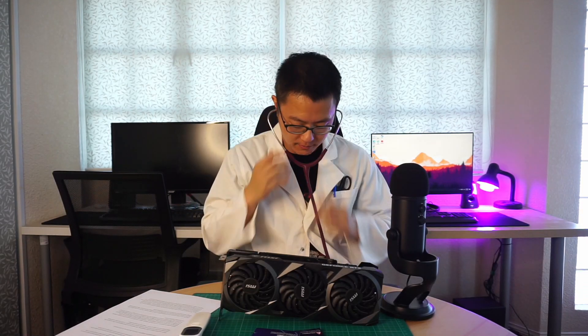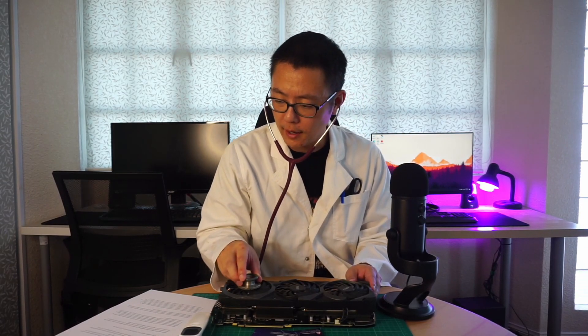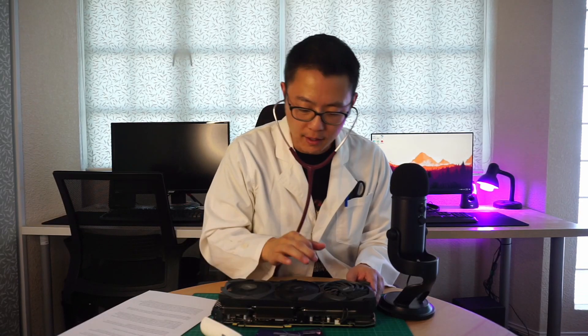Let's take a look at the problem. Yes, everything seems okay. Let's take a look at the GPU core temperature — 51 degrees. Seems like the fans are working properly. The core clocks look pretty good here. Let's take a temperature on the back side. Oh yeah, I see what the problem is here: 88 degrees, 90 degrees, 92 degrees, 94, now 96 degrees. And that's much higher than last week.